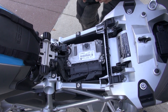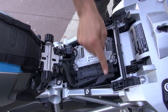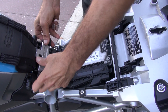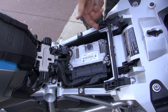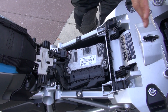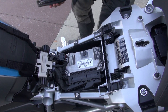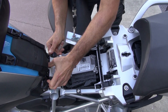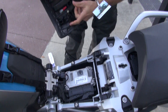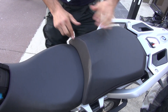You've got two components to adjust the seat. The front component has an H on it, the rear component has an H. By flicking that, you get the L for the low position. You can actually go high at the front and low at the back, and vice versa — so it's very tunable. The pillion seat is adjustable in fore and aft as well. The seat locator simply slides forward and the seat's on.